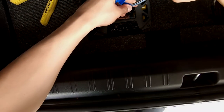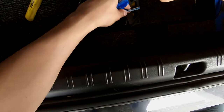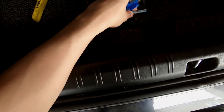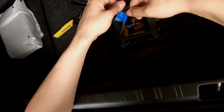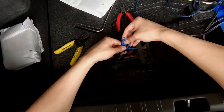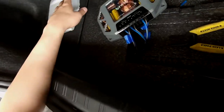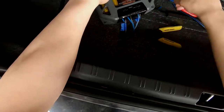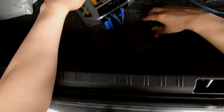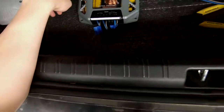We'll cut and separate the wires so we can put them into the right terminals. Like I said, this is how I install them because I'm amped so I had to run new wire. You don't have to run new wire — you can use the existing wire if you're just using stock power or radio power. Two-way setup with tweeter on low, and now it's time to test.